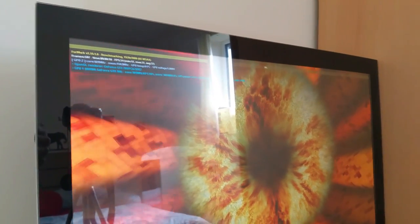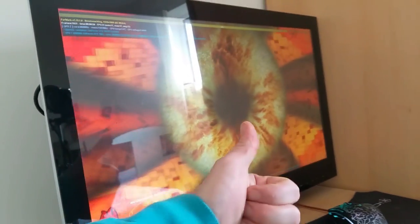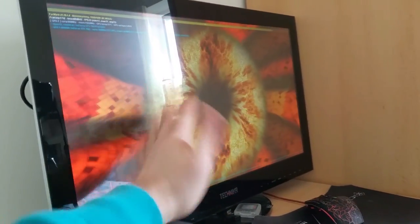Yeah, I think we have successfully repaired this card! The jumps up and down can be because Windows is doing updates in the background since I'm not using this PC regularly. Look at that: 33, 34, 34. Core clock is 980 and temperature is 74 — which looks amazing. Well done! The card is hitting 99% GPU load and temperature is going to 75 and no more. Core clock is 915, which is the full speed for this card.